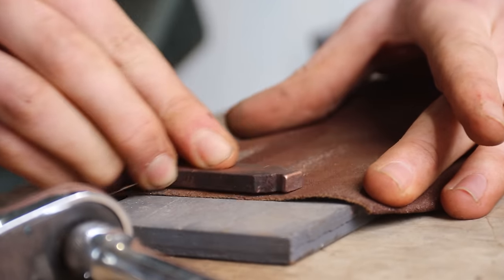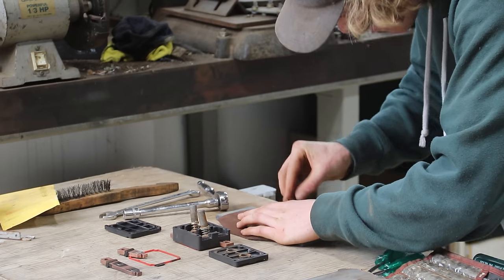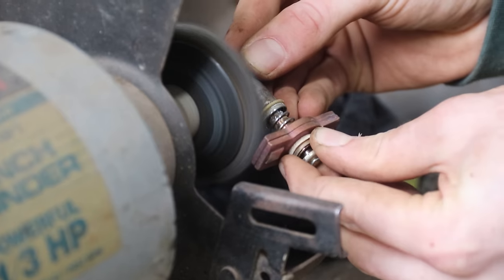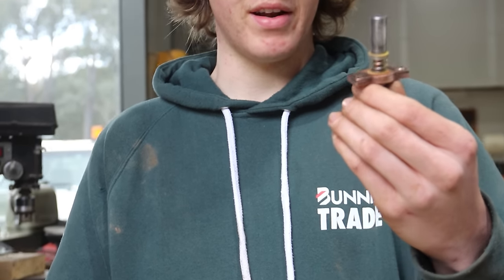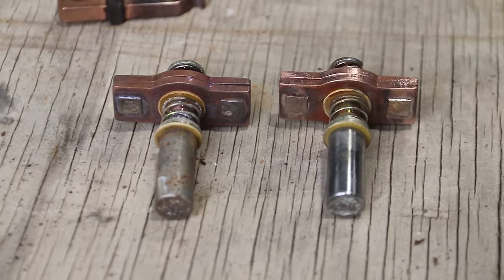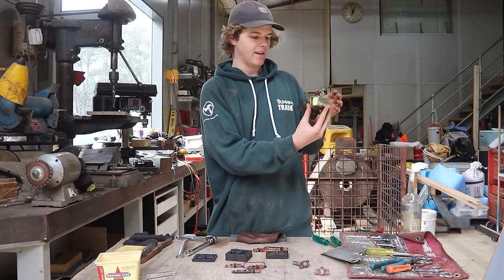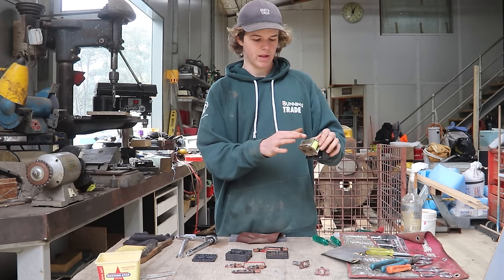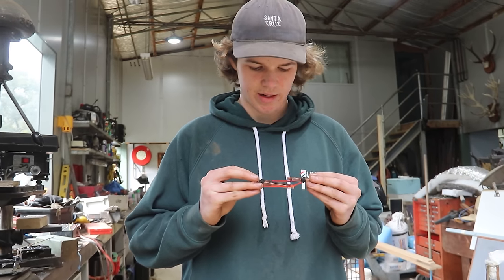What you want to do is clean up these contact points top and bottom and also on the back side, making them as flat as possible so the contacts are good — that's how we get our best performance out of the winch. As you can see, here's one I've just cleaned up on the bench grinder and that's one before. Our ones are now pretty shiny, which means they are nice and clean of corrosion. We've just got the coils out of the oven — they're nice and warm. We'll let them cool down; that should have got any moisture out of there. We might give the exterior a careful hit with the bench grinder to get rid of some corrosion.